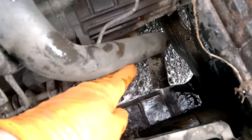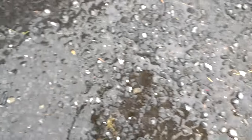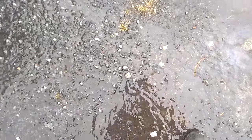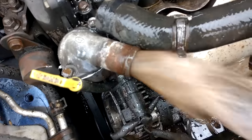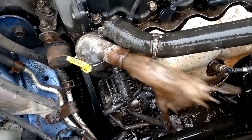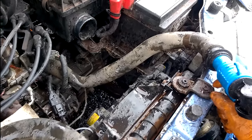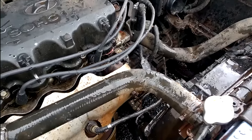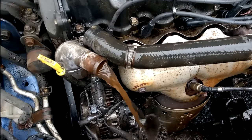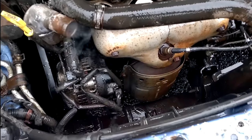I'm flushing it through from the thermostat side now — that is all extremely dirty coming out there, it's filthy, very brown and thick. Now I'm in the bottom hoses with the heater core reconnected, flushing through the system again. Every now and then I give it a pressure shot — soaking myself in the process — but getting all the crud out of it.